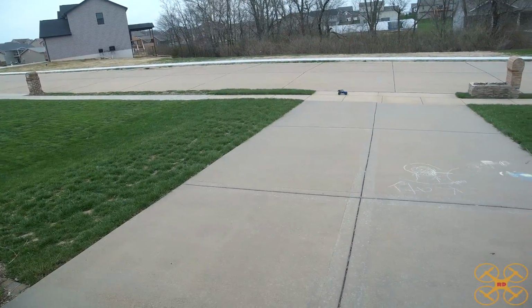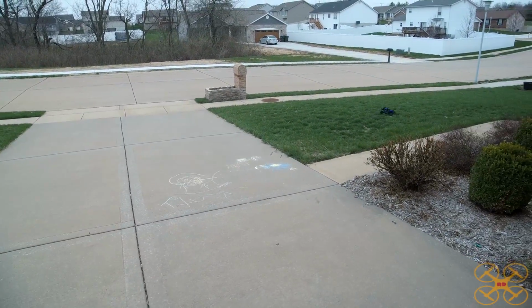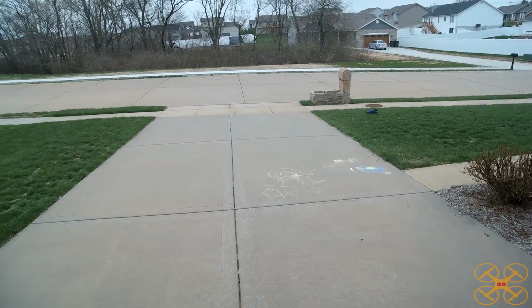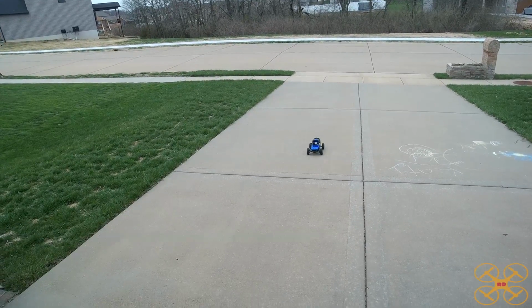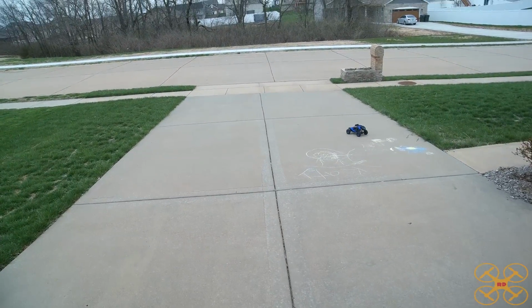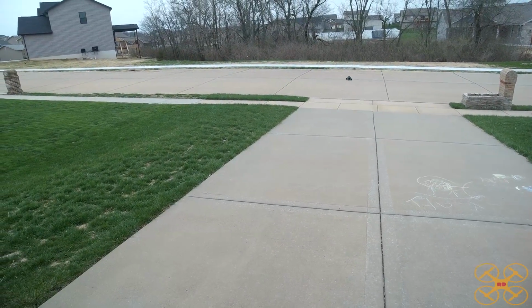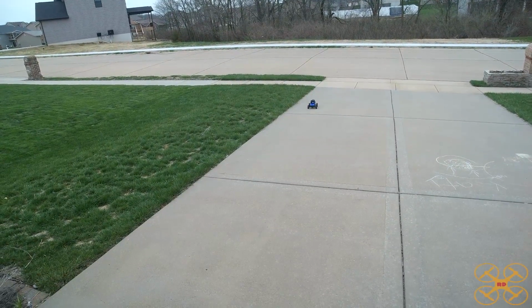But it's awfully bouncy. I think if it had oil-filled shocks, that certainly would help. It's also the design. That one piece back rear end with each independent shock is not as good of a system as the front independent suspension. So that makes it also a little bit bouncy.